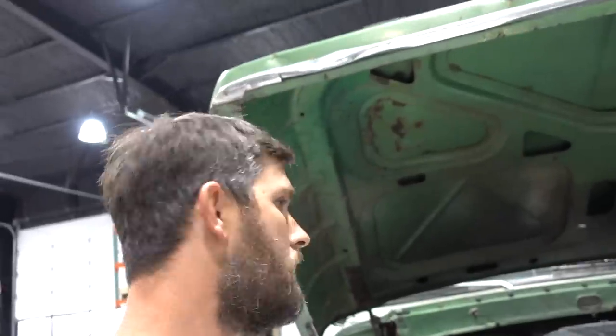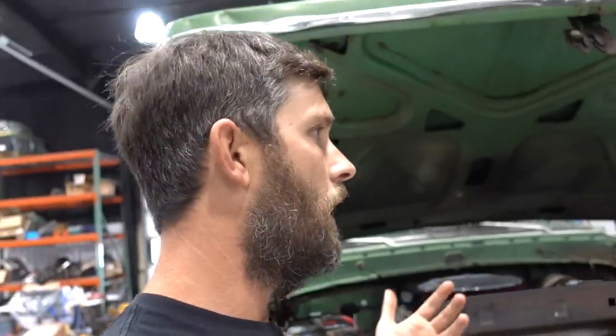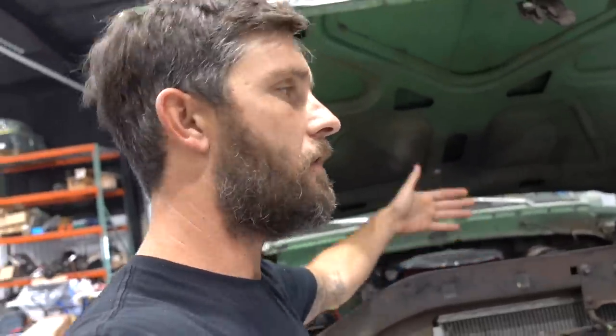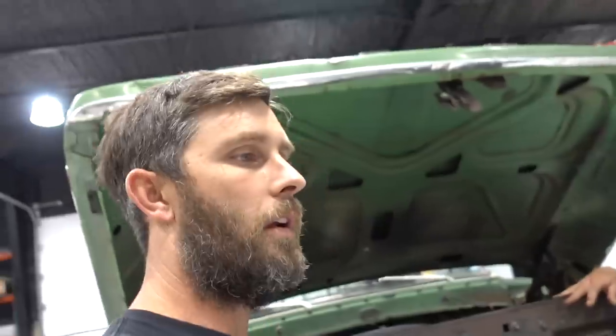So we did run into a little bit of electrical gremlins. I had the wrong trigger wire. I was trusting wiring that existed on this truck that needed to be repaired. So I had relays clicking when they shouldn't because it was pulsing off the voltage regulator up here. So we ended up tying back into the original coil power wire. Things like that you're going to run into inevitably.